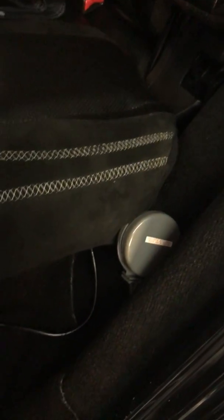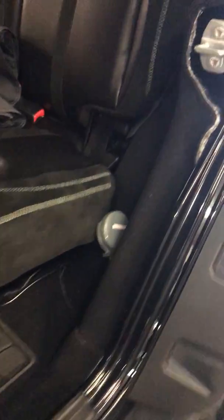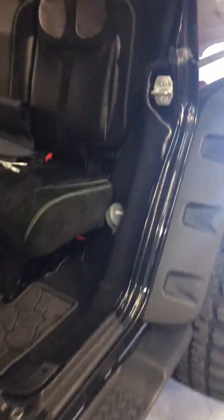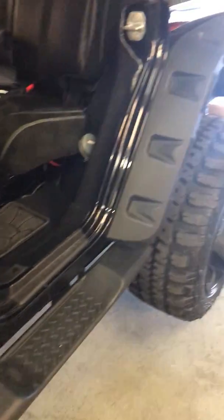By the way, you're going to need a clean air filter — that's going to come out from the end of your air compressor. I routed it up so that it went into the Jeep so that it stays clean and stays away from any dust or anything like that. I put it here because one, it's a good area for it, and two, since my vehicle's a show vehicle I really don't mess with it much. If I ever want to open the door, it still gets clean air, and I can hit the horn. When I hit about 100 PSI, that's when it turns on. You want to definitely hook up the pressure switch so that it knows when to turn on and when to turn off, because if not, you'll literally have a bomb there.